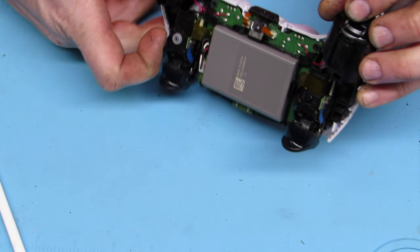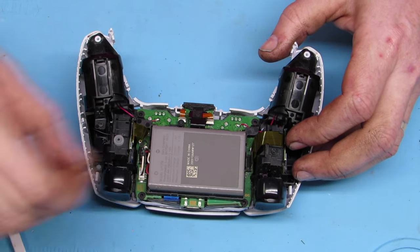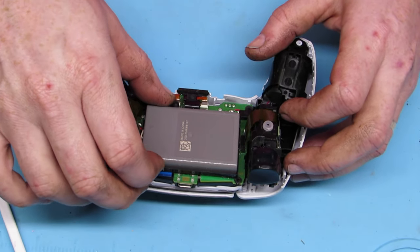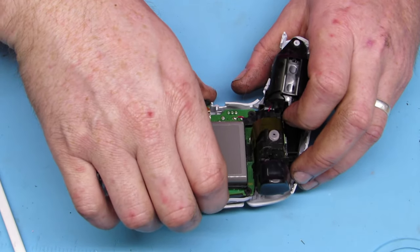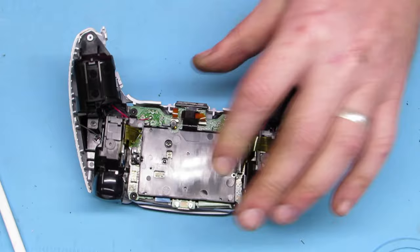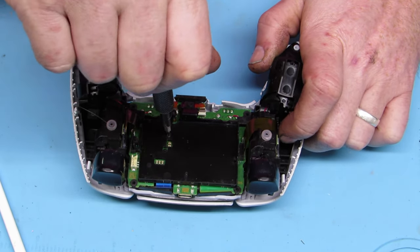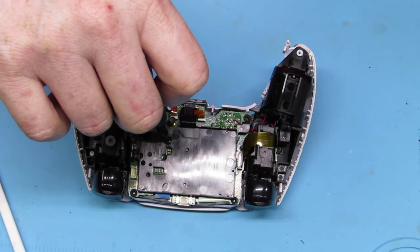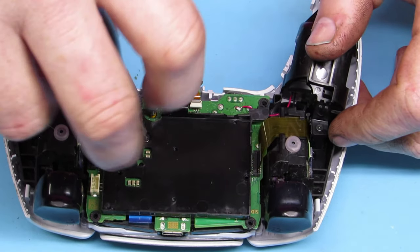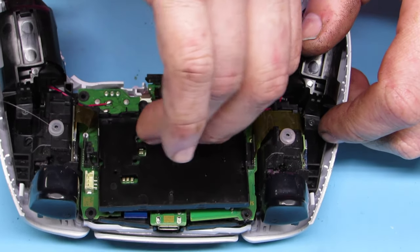Pull it down and out. There are little silicone pieces right there — one fell out, so I put it right back in. All is well. Next thing you want to do is pull the battery. It's not screwed down or anything; you just take the cord and the connector and pull it off. There's one screw holding the battery tray to the board — it also holds the bottom microphone.